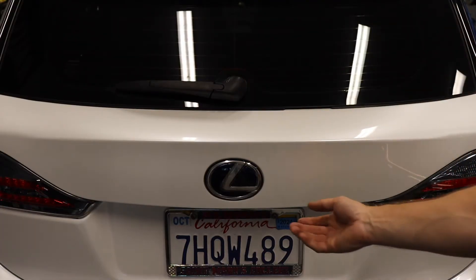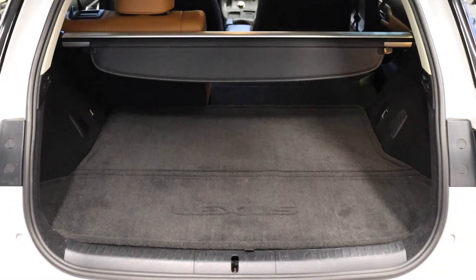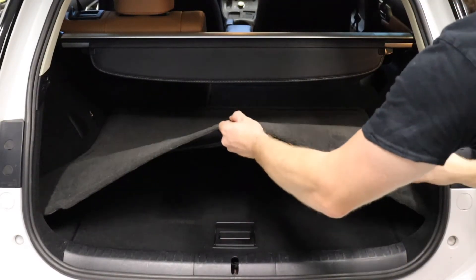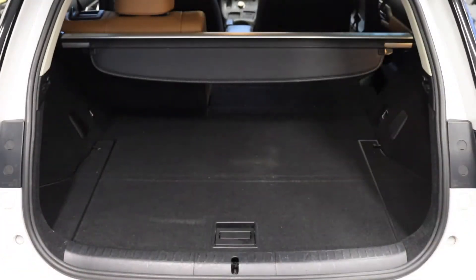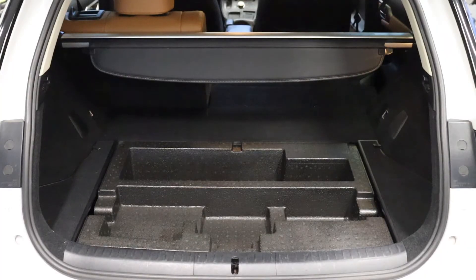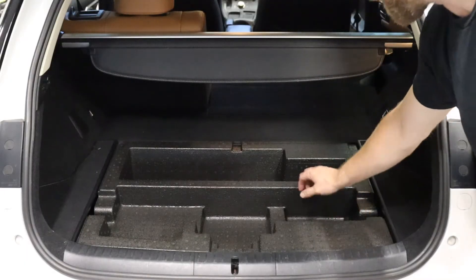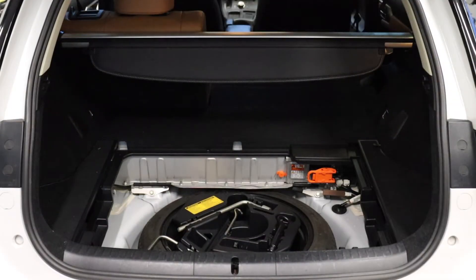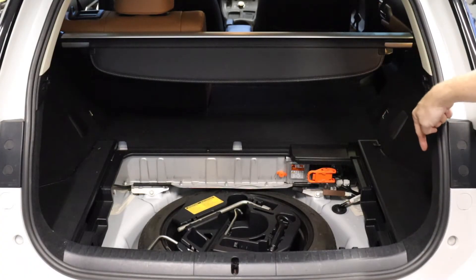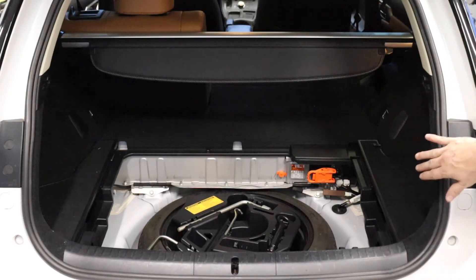Obviously, we need to pull a lot out of the back of our car, so let's open the hatch and yank everything out of here. You have one of these nice little carpets — go ahead and pull it out. Then pull off this little floor part here; you've got your little cool container stuff. I think they just did this to fill the space because the hybrid battery is up there, so go ahead and pop that right out. The spare can stay — we don't have to mess with that. But for safety reasons, we're going to go ahead and disconnect the battery, which is located right here, because we're going to be messing around with electrical things.